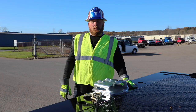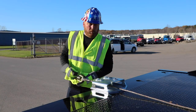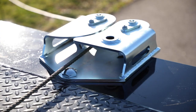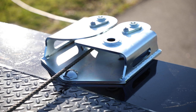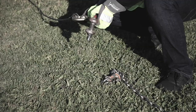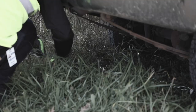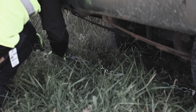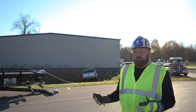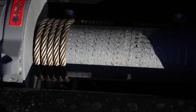Now that the attachment is installed, feed the wire rope through the device, pull it through, and go out to the casualty. On this carrier we have 50 feet of wire rope — not enough to reach, so we used a 20-foot 3/8 grade 80 chain to reach the casualty. On the casualty we have a 3/8 grade 70 V-bridle hooked to the rear axle. We'll need to winch it some, block it from rolling back, pull the wire rope back out, and winch again. Always make sure you have a minimum of five wraps on the wire rope drum or it will pull out.